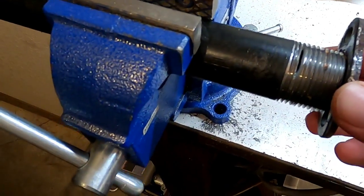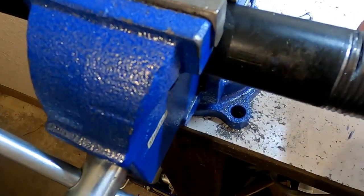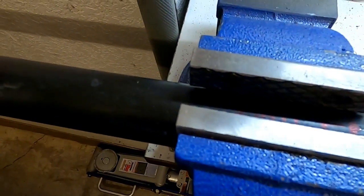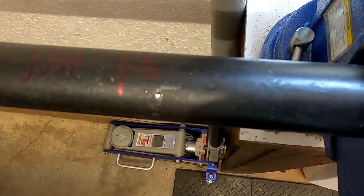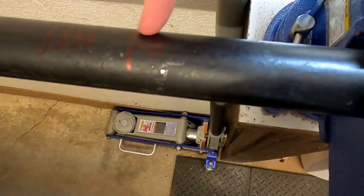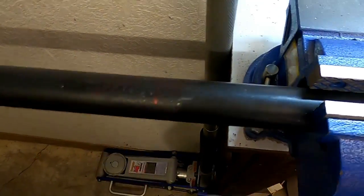The general idea is basically going to be this. I'm probably going to grind it on a bit of an angle so it tips out a little bit. I've got my basic length measured out, and I've got that mark — you can't probably see it with the marker on here, but I can. This is about the top that the muffler is going to be. And I'm actually not going to cut this to length at all until this is done — we can always cut more off, but we can't add it back.